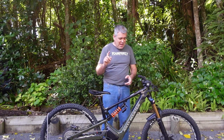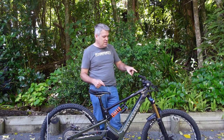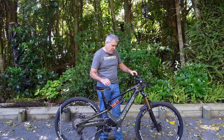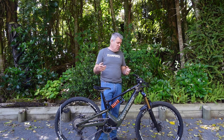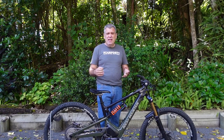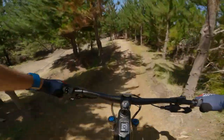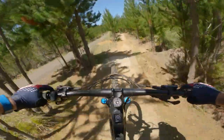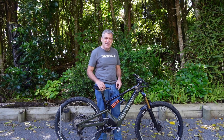If you're the sort of person who likes a bike that you can really play around with the geometry, this is definitely the one. The other thing I really liked - and I think some other manufacturers need to take note - is the display and the controls. Nice simple little button, nice and ergonomic, you don't really even notice it's there. Nice display on the top tube. It comes up with a Rocky Mountain display showing all the information - battery, levels. There isn't an app with this one, but you can press the button and scroll through to set different power levels for each mode, even have presets for different types of riding. It even has chain calibration - as the chain grows and stretches you can recalibrate so the motor detects that. Pretty swanky stuff.